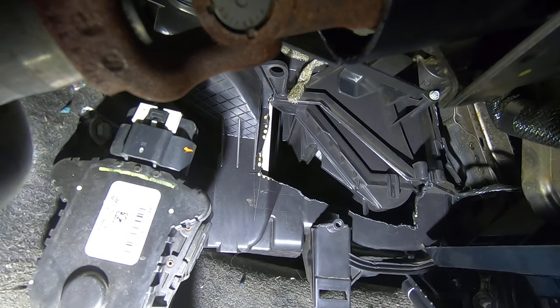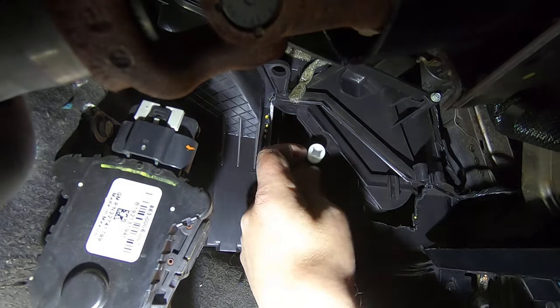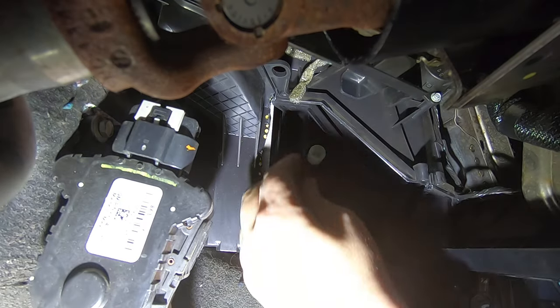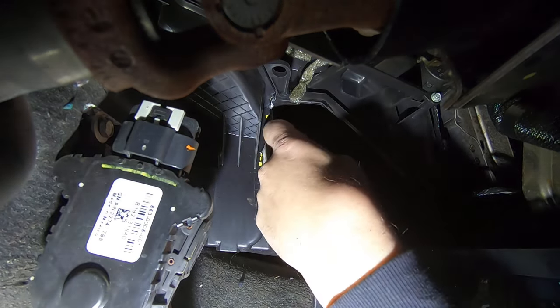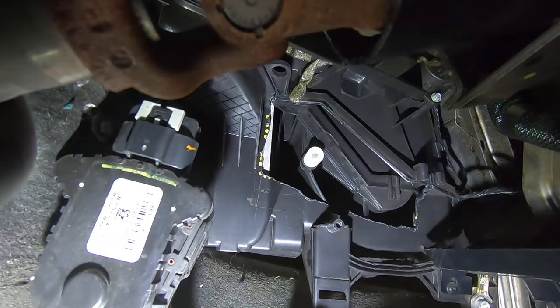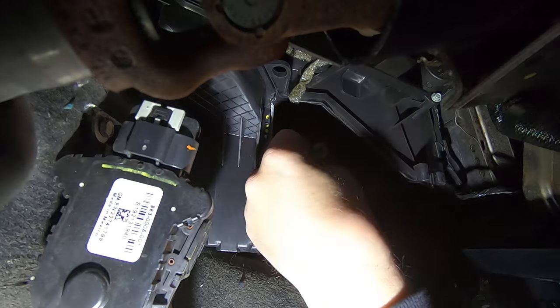And I am going to mount the camera back and go through the installation of it. Okay, first step is you got to put the new door in. Now there's a little boss on the other end of this that you got to make sure this door makes its way into. And you'll know because you'll be able to swing this door by hand, closed and open.